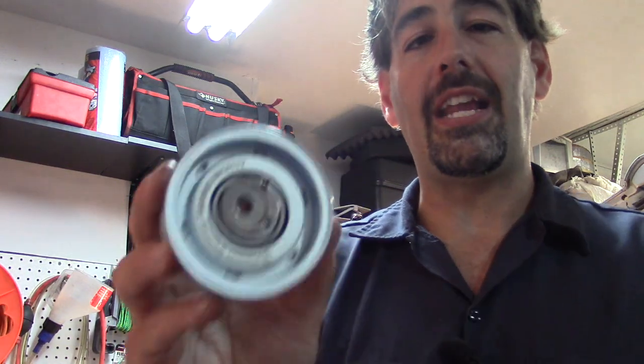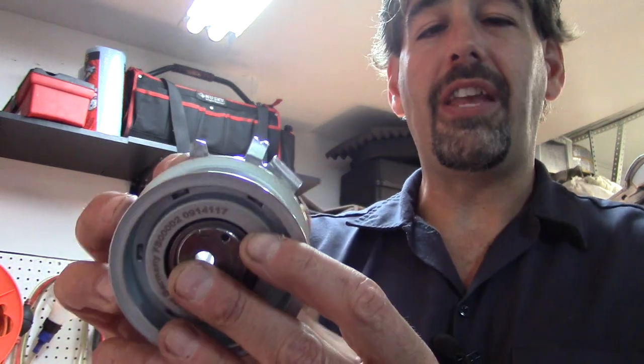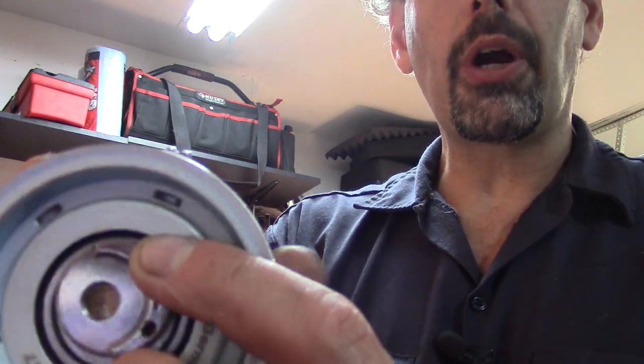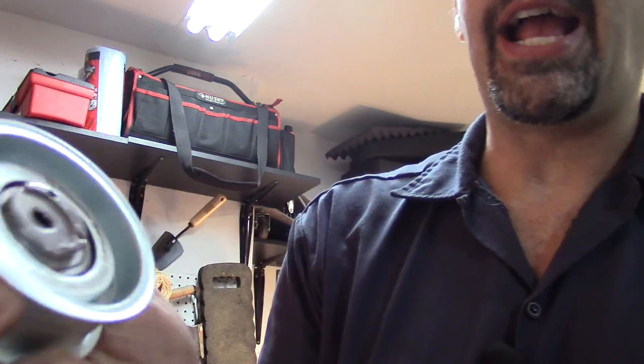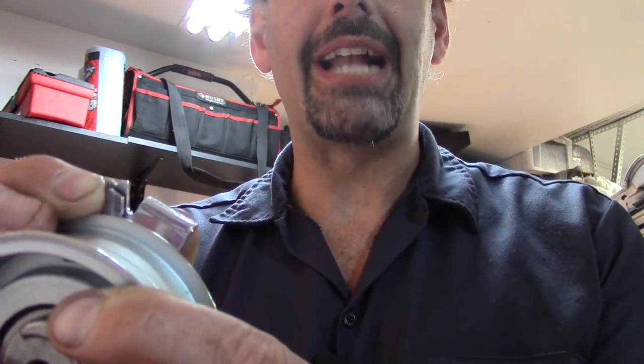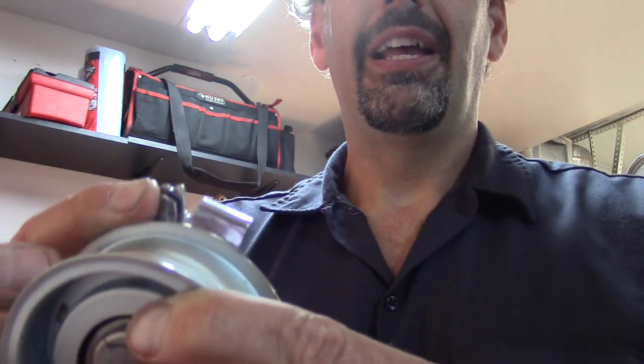That's the part that's missing from pretty much every other YouTube video I've seen on these 98 through 05 Jettas and Beetles with the 2.0 liter engine — engine code AEG or maybe also AVG; it would be the same kit either way. This is the new timing component for the tensioner. You'll see there is a little marker here and a little notch here. You'll need some kind of special tool to fit in here, and you line up so that the lever lines up inside that notch. When the timing belt is installed and those line up, you know that the tension is correct.